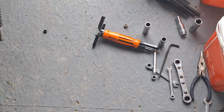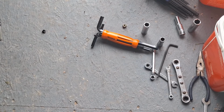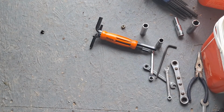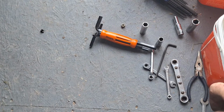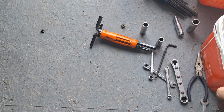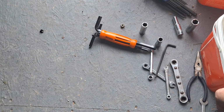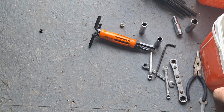Like exactly 25 years old. Unless this came out in a 96 or 99 model, that was an early release. It came out in August of 99 or whatever, but just figure 25 years old, and they do go bad. A simple little trick there, if that's happening, you can just jumper those together. Like I said, cut the wires, solder the green wire and the black wire together, and just leave the gray wire, or whatever color it is, open, or cut them all off, and put heat shrink over the 12-volt wire, and you'll be good to go.